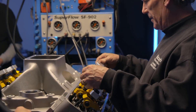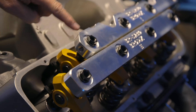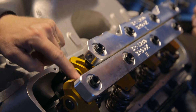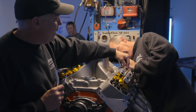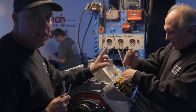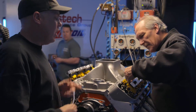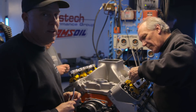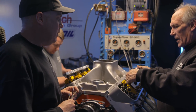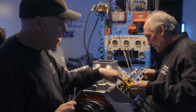What Steve's working on right now is what's called a stud girdle. It uses a really long polylock, which is the thing that holds the rocker arm down. It is a clamp that goes around each one of those polylocks to stabilize all of these rocker studs so they're not wobbling around with the high spring pressure and big lift and potentially high RPM of a solid roller cam. This thing doesn't really have an RPM problem, fortunately. But this is still going to add valve train stability since we don't have a trick shaft-mounted rocker — it's a regular old stud rocker.